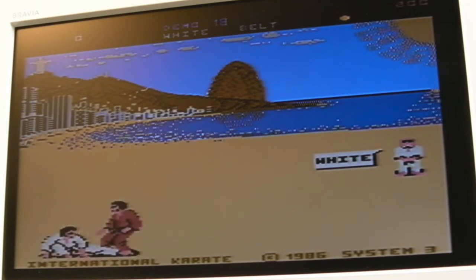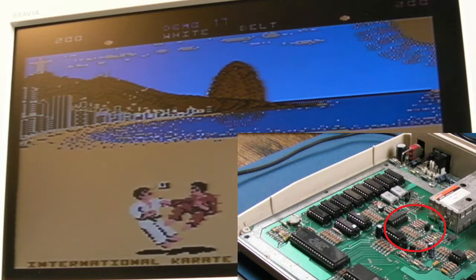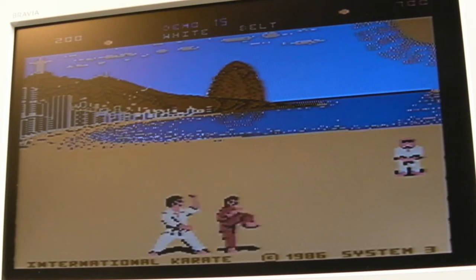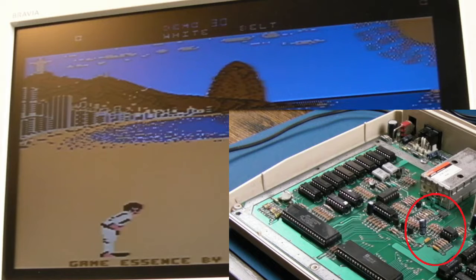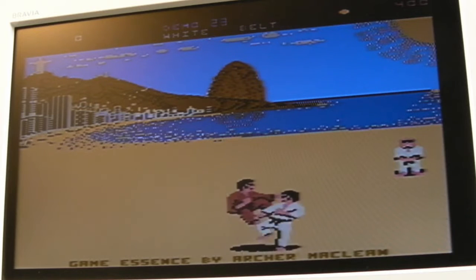Then again, the colour's not going, but when I was in the middle of the board here, just around these things near the modulator, let's just try that. Yeah, look, the pixels are going weird. Focusing around the small 8-pin DIP, see nothing at all. Around the 3 transistors there that merge the, is it the Luma? I forget. Nothing there. Yeah, there's also an IC there for a CMOS, wasn't there?